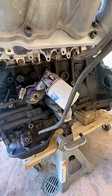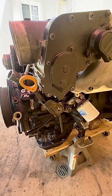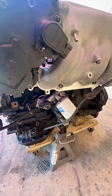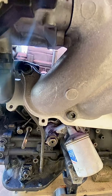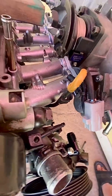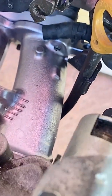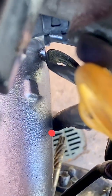This is the OEM dipstick — I forget if it's an IS300 or GS300 one. There are no provisions to mount it after the modification, but what we found is you can put it in front of the first runner without even bending the tube and it fits pretty good. To mount it, you'd have to bend the tab on the oil dipstick — bend it up and slightly to the left — and there's a bolt hole on the flange you can meet up with. It's under that rubber hose and it's a 10mm.